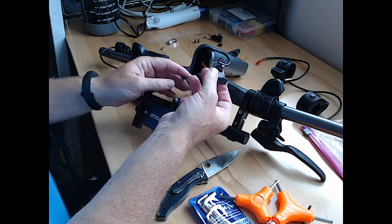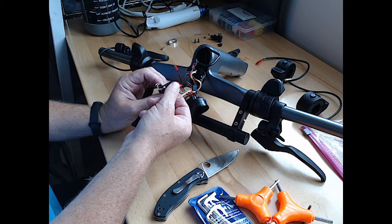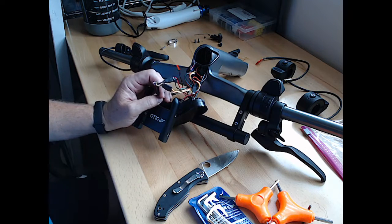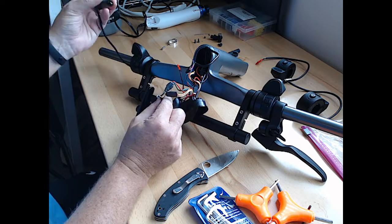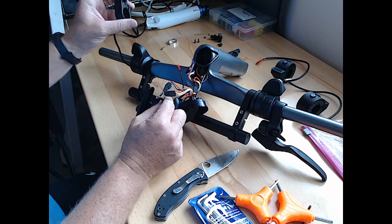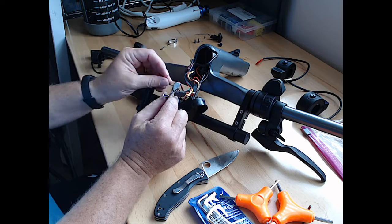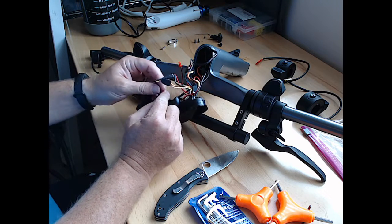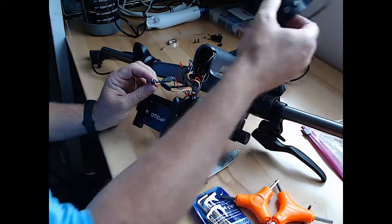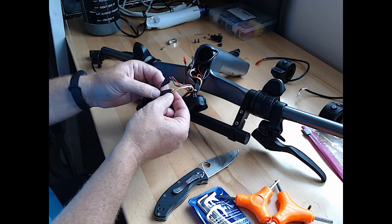But, all right, so this one that goes that way, interestingly, okay, so two different things. We got the brake lever cable, which is the one we clipped. We're keeping this. We're not getting rid of this piece of it at all. So that cable is going to stay and reconnect back up to the single three-wire cable. The throttle assembly looks like it's got two cables, which makes sense because here's the new throttle. It's got two cables, and that is going to reconnect here.